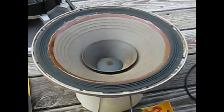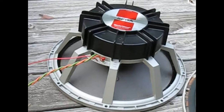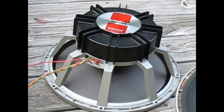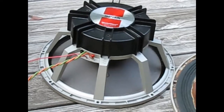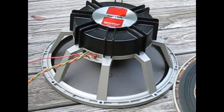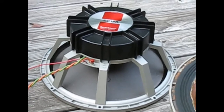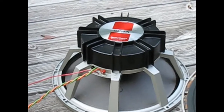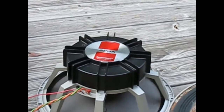The reason I'm doing this at this juncture is because this woofer is just distorting like crazy. This speaker was always defective even from brand new, but I used to be able to crank the stereo up and it got rid of the distortion. Somewhere along the line I eventually blew out or cracked the voice coil in half or something. It still works but it distorts badly. If you even move the cone manually, you can hear a clicking and grinding type noise — there's flapping or something going on, and it seems to be rubbing too.